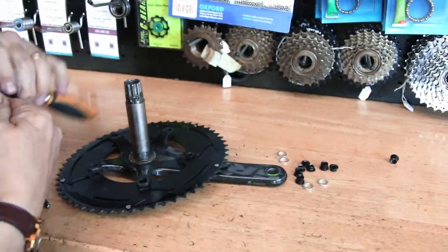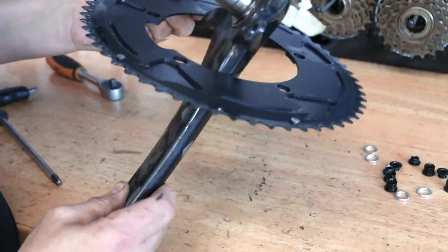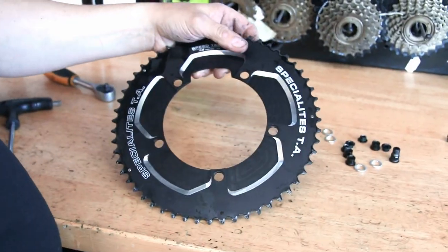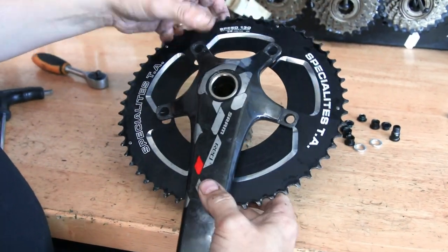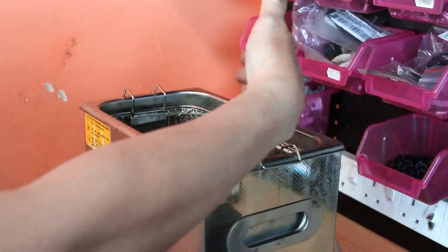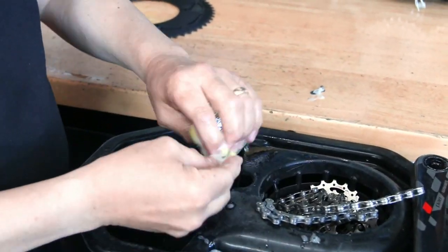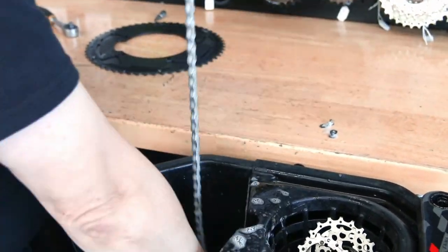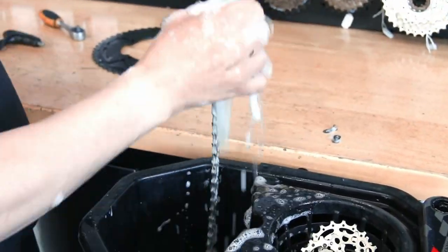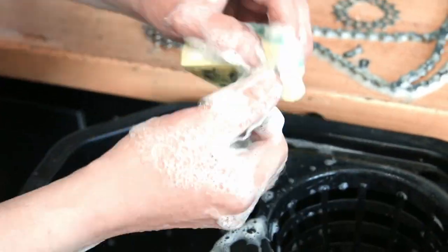These spacers are male and female and they were actually the wrong way around. The female part should have been on the back of the chainset and the male nut and bolt on the front. Also, this hole here that I'm showing — it was actually crooked and should have been opposite the pedal arm, so we put that right when we put it back together. It didn't make a lot of difference mechanically, but it just meant all the logos and everything lined up.